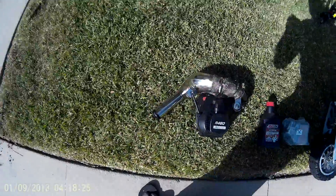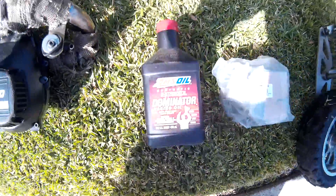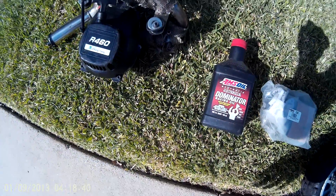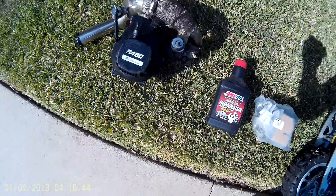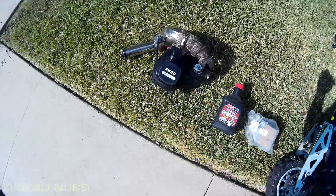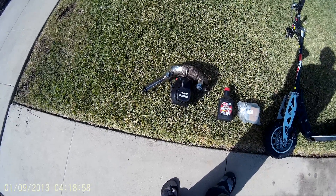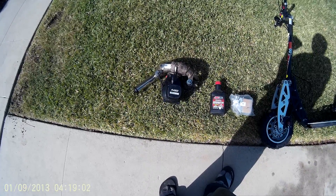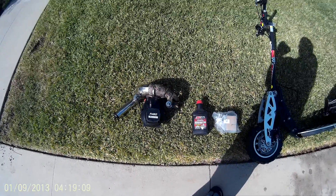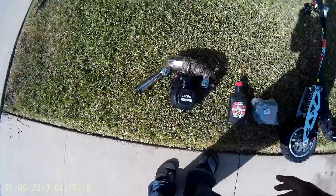So the first upgrade I did was the break-in. I broke it in with Amsoil Dominator oil — that stuff was a business. I did the heat cycle thing: 15 minutes running at idle, give a little gas here and there, then 15-minute cycles. I did a whole gallon of gas before I really ran it — four full tanks of that cycle, babying it the whole time. I kept it in first gear, revving slow, then working up to second.